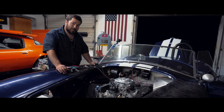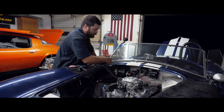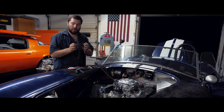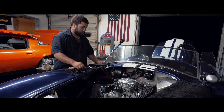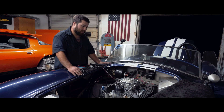One of the biggest things about making an engine bay clean is making sure all your wiring is routed in tight and in a good loom. Some people use the plastic, but I prefer the split braided loom — it's easy to wrap around the wiring and it looks really nice. Take your time, make sure everything's routed away and nothing's near anything that's going to get hot.